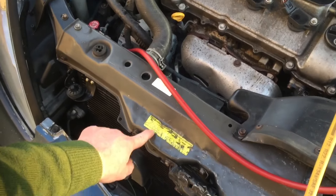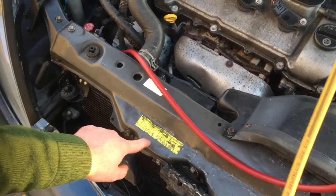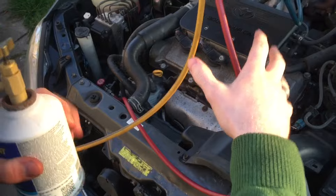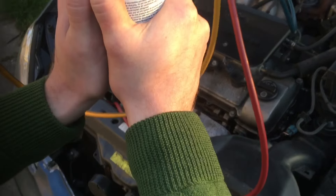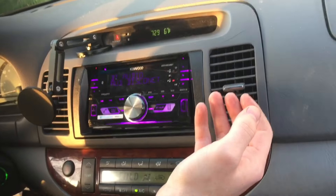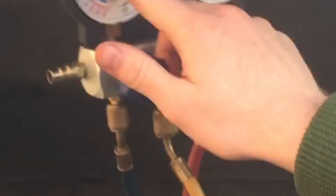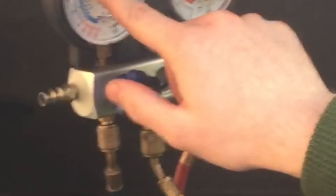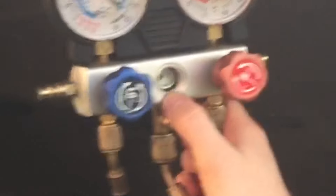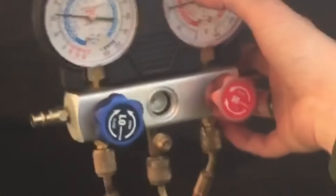I'm aiming for the minimum of 1.1 pounds, so if I overshoot I still have a little buffer before I hit the max. Eventually this can will get really cold — I wouldn't recommend setting it right on the engine, but you can take your hands and warm it up and you'll see that pressure continue to go back up. Take our temperature gauge and put it right into the vent to read what our temperature is. Already I can feel the AC getting cold. You'll see this cycle repeat — the pressure goes up, then the compressor kicks on and back off, and our pressure goes back up.